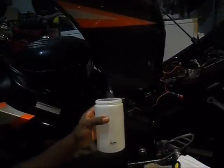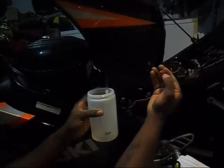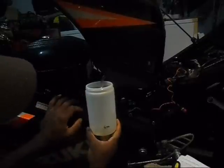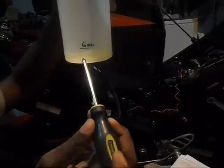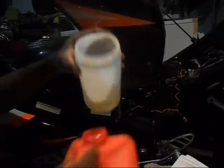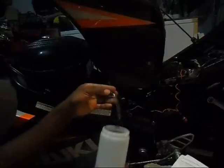Okay, we're still going. Well, the point is even at ten Mississippi — I forgot to press the button, but I think that was going for about 15 seconds. I forgot that my interrupter was a click — I had to push it and push it back in. But even at 15 seconds, which is five seconds more than it needs to run, I'm only getting about this much fuel. When it was at 10 seconds I was probably significantly lower than the 5.7-ounce mark. Yeah, that sucks. I don't think I'm getting the right amount of fuel and that could be my problem. I'm going to try it one more time at 10 seconds.